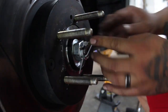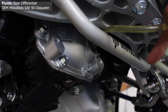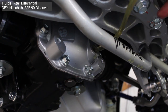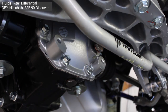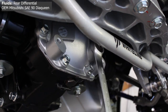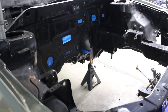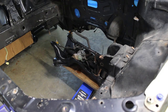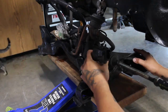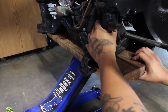To ensure longevity of the wheel bearings, make sure to always torque the axle nuts to spec. We will have to circle back to the front subframe and steering rack. At this point, it is only being mounted temporarily so we can transport the car to Michael's shop. So everything is just tightened snug.